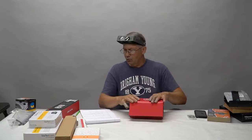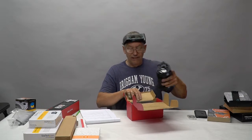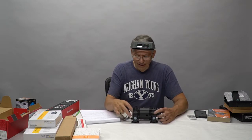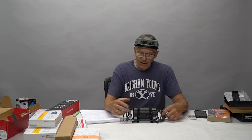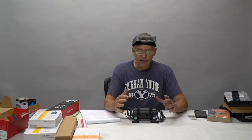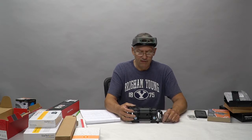Now the pump. Just briefly. Okay, I talked about redundancy before. EK is renowned. They are the top of the line as far as water cooling goes. There is a pump, legendary pump, called a D5. It is a brute. It is designed to run all the time. Now, EK came out with these D5 pumps that have PWM, so they've got this beautiful fan control. So we can set the pump speed based on the temperature of the system, so we don't have to have the pumps running 24/7.